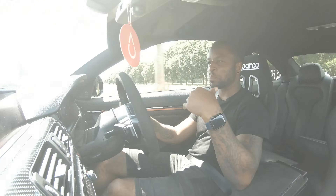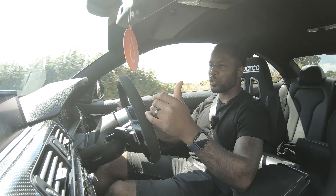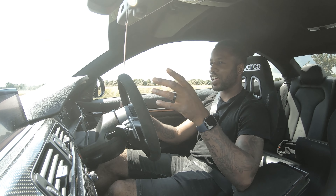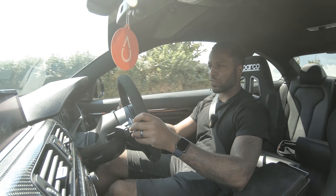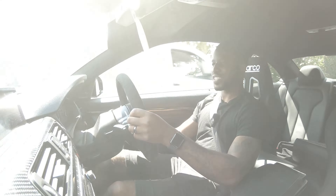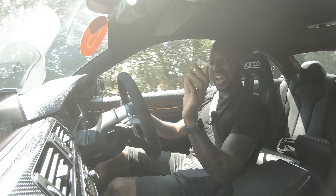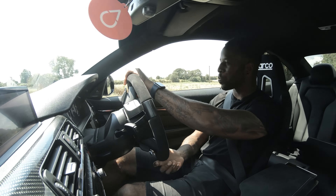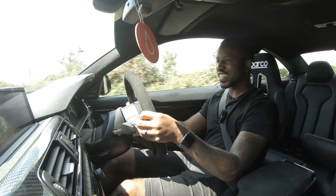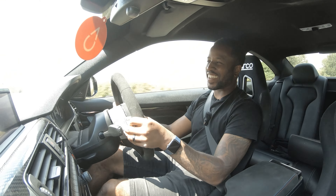Based on that little rev, I know it sounds better. Right now we're driving and it's beautifully buttery smooth — no drone. It wasn't that bad before but it wasn't as smooth as it is now. M2 button, traction fully off, sports throttle meaning the flaps open up when I get above a certain RPM. It still sounds loud but not stupid. I have to be careful because in the back we've got the mid pipe.